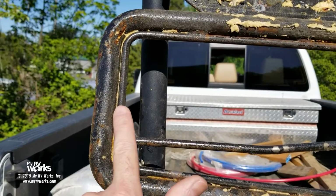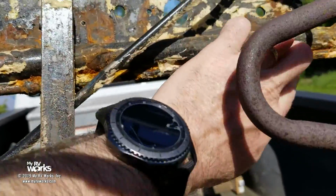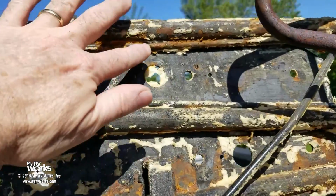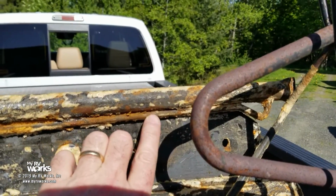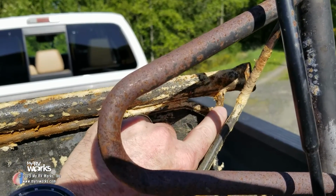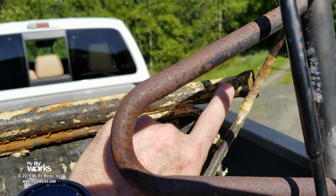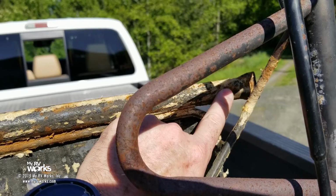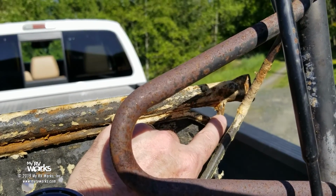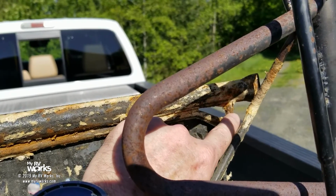But what's going to happen is that ammonia and that hydrogen is going to work back up this tube. Still, it's like pre-cooling itself, and it's just working its way around and around. So that ammonia liquid and that hydrogen gas is in this tube, and look what they do right here. They join this larger tube. This is where the vaporization of the ammonia begins. When it goes from a smaller tube to a larger tube, this is the point where that ammonia starts to vaporize into the hydrogen in a larger tube.